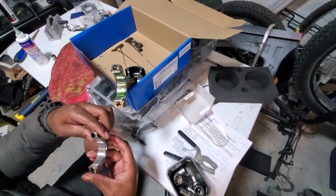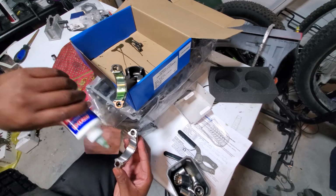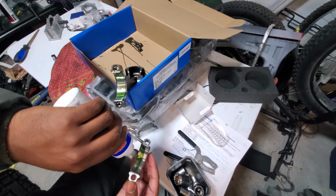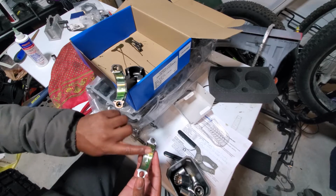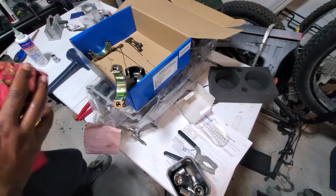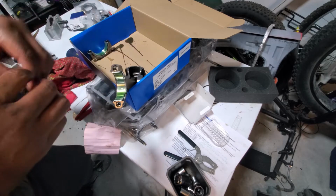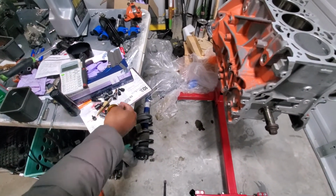So clips in, slide over just a bit. Feels good. Take the assembly lube. Rub it in, rub it in, rub it in. All right, so that's how you do that. Now I'm gonna take these bolts and stick those in the oil while we're dealing with the piston, getting in the hole. And these will already be soaked by the time we get ready. So let's walk back over. Do exactly what I just said.